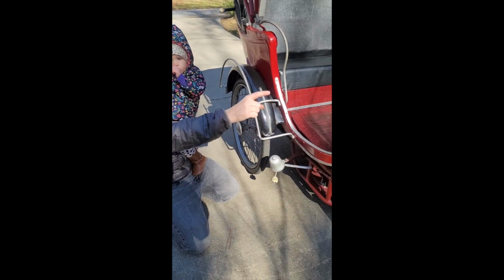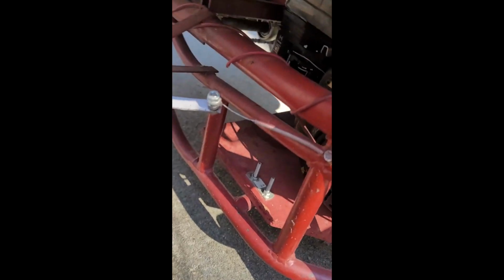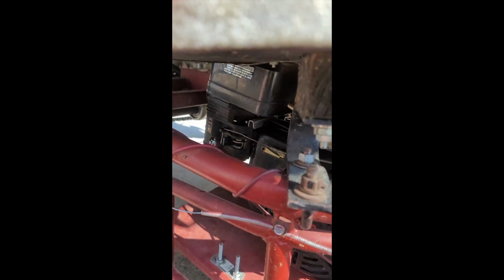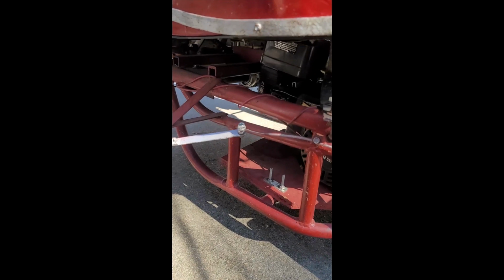One thing I wanted to mention, I showed you how the choke works and how it's labeled throttle. If you follow the cable for the choke down, you'll see it's connected to one of two levers in the engine. The choke is the lever on top, and the lever on bottom controls whether the fuel is getting to the carburetor. If you're familiar with motorcycles or other small engines, oftentimes there'll be something called a petcock, which turns off the fuel at the tank.